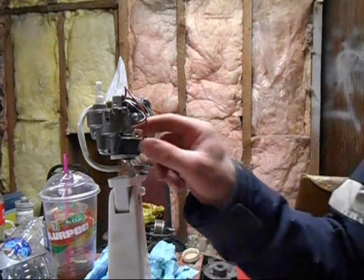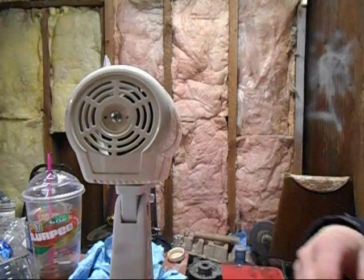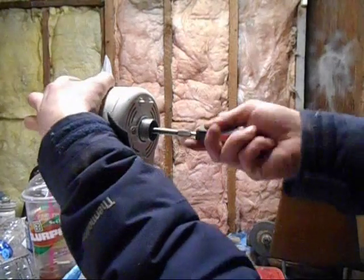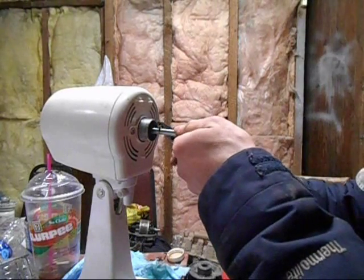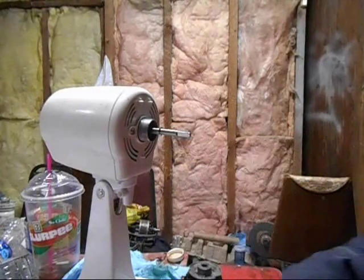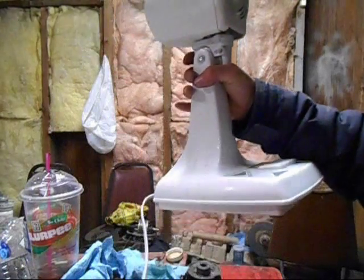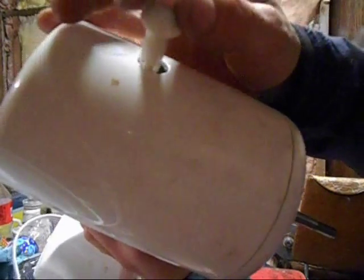Right on, I'm gonna put that capacitor on. You should tighten the front up before you tighten the back up. Pop your little blade holder clip back on there — takes a little bit. There's our oscillation knob. Now, on your fan you might have to screw it back in, but if it's the unclipped kind, you simply clip it on — very simple to put on, not tough to take off.